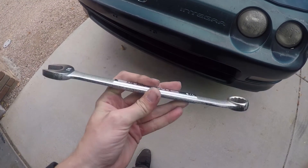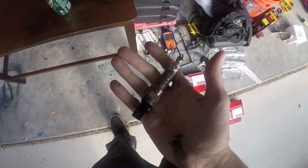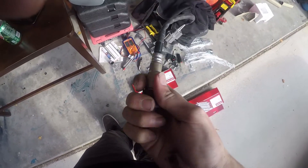Okay, so this is the wrench that I need. It's a little bit bigger than I thought it was going to be. Let's get under here and rip out this sensor. Victory is mine. So here's the million dollar question — where did I put the O2 sensor? It's right here. So this is the new one. I'm going to put this one in, hopefully not as bad. The tin's back on, the O2 sensor is in. With the right tools, it's fine. It also helps to do a little investigative work and cut the wire, then have the right tool. That's it. We can move on to wheels.